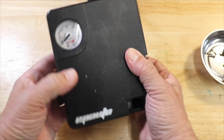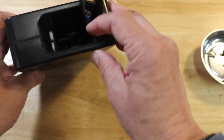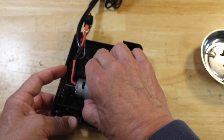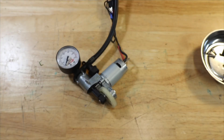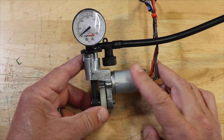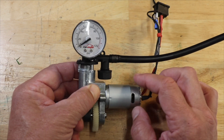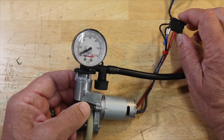You kind of take Amazon ratings with a grain of salt. This is basically how it would look minus the switch, and you can see the cords come here with a little stuff pouch for the cords. This part and this part would come out. Here's the fan that we would remove. Here's the guts of the pump: obviously the motor, your compressor, your flywheel, pressure gauge, and I think this is some kind of pressure relief system so it doesn't blow up on you. I kept the switch — I probably could have pulled it out and wired it directly in.